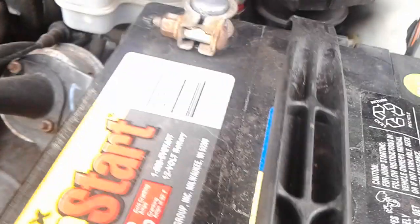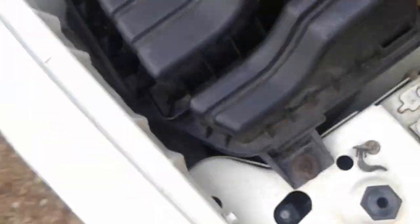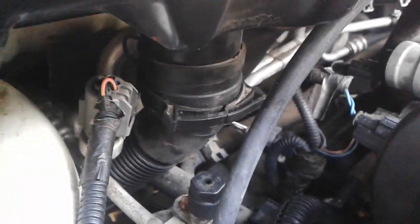So another one you'll see in here, and I'm actually impressed with this. These vans have like a gutter. You have these drain hoses that come down and they go behind the axle on each side. Here's a better look at the other side. And they say clean these out. These are plugged up all the time.